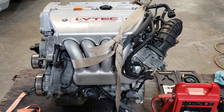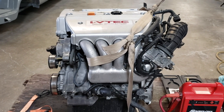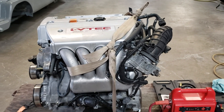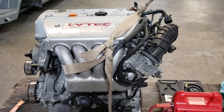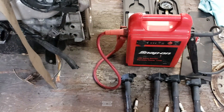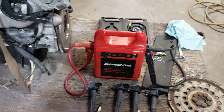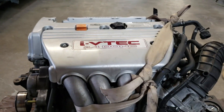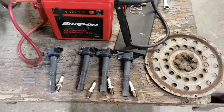In conclusion, if you're doing this test yourself, you are doing this at your own risk. If you don't know what you're doing, you should get a professional mechanic to do it for you. There is another way to do a compression test with the motor out of the car — it's called a leak-down compression test, which uses an air compressor and a leak-down gauge tester. I use this test when I'm buying a motor to make sure the compression is good. With this motor in this video, the engine is bad — compression is very low. I want at least compression to specification for this particular motor, and within 10% across all four cylinders.